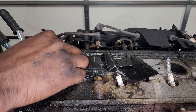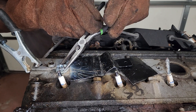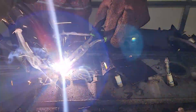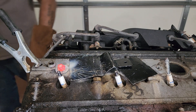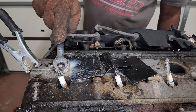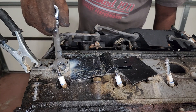I've got a little ball on there — it's still hot so I don't want to do too much. Put the washer over everything. I'm going to take this nut, sit it over the ball, and then weld all that into one. The first couple of tacks I'm going to try to hold on to this with needle-nose pliers. I'm going to let it cool just for a split second. I like to wait until it turns not glowing to get it off, and kind of let the bolt tell you what it wants.